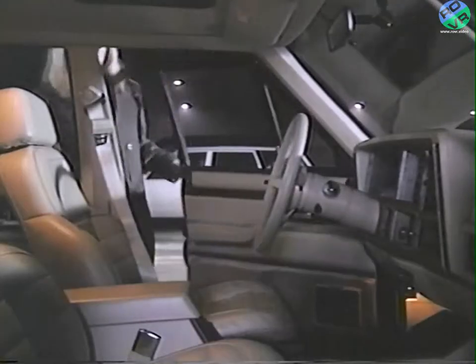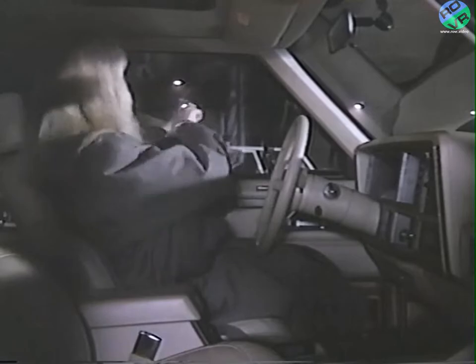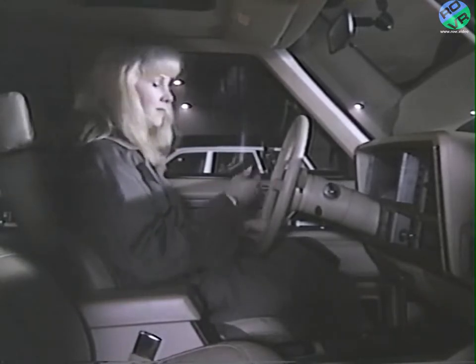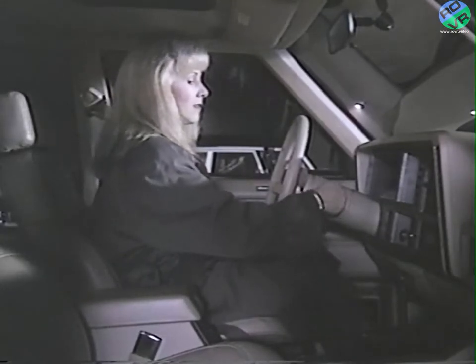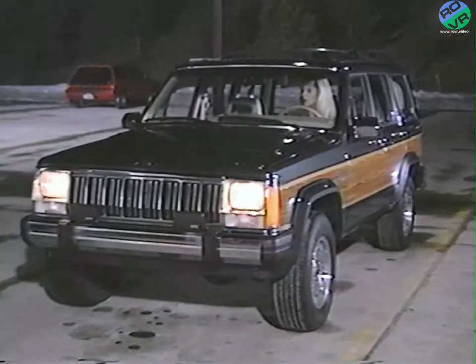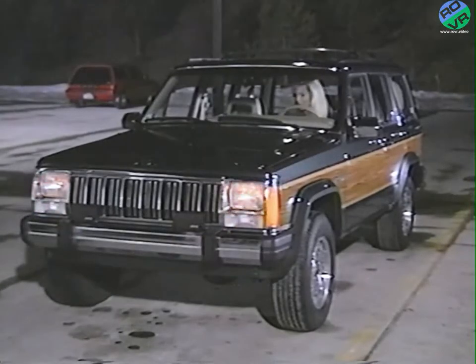One method is by pressing the keyless entry transmitter while in the vehicle. If this is done prior to the vehicle being started, opening a door or operating the ignition will trigger the alarm and the engine kill feature. The SAM has no way of knowing that the system wasn't armed from outside of the vehicle.